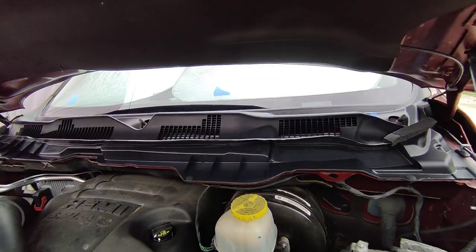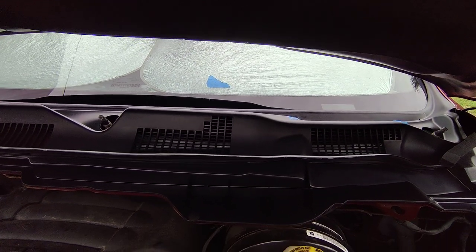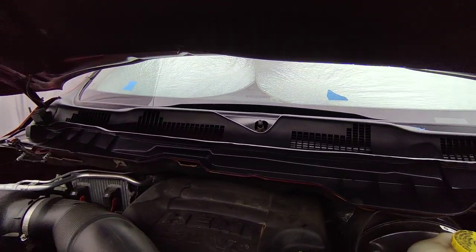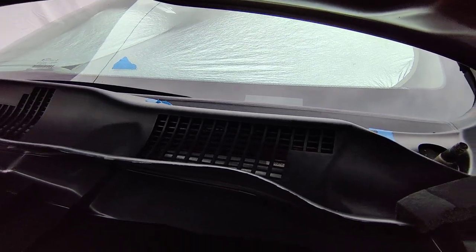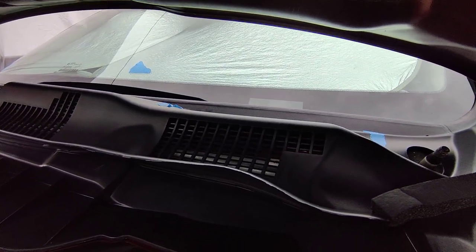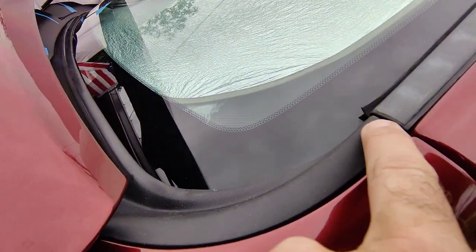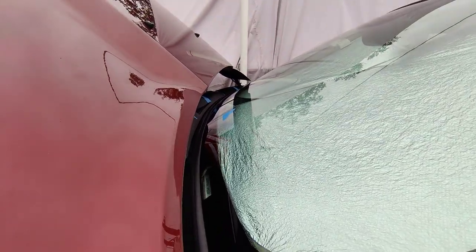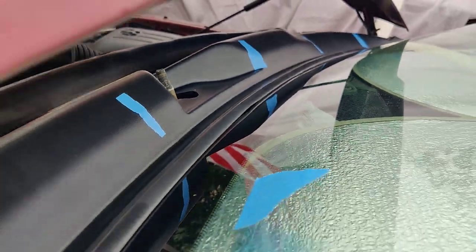When you do go to install it, I suggest starting kind of from a little over from the middle, and pushing down and sliding it up to the outboard. And then from the other clip, going to the outboard, pushing down and sliding up. Then once it's in place, get yourself a nice flashlight and look through the vents — you can see the clips underneath the windshield. You just have to come back and tuck this piece in underneath there and tuck in that piece there. There is a slight little gap between the windshield and the seal, but I'm hoping with some heat in this nice Florida sun, it will lay flat.